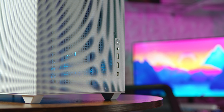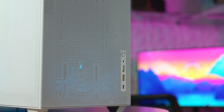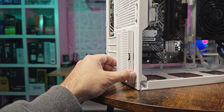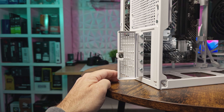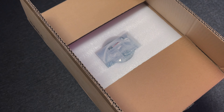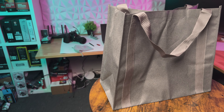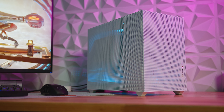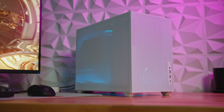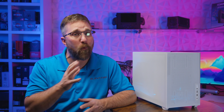Interested in water cooling? Just remove the top fan bracket and attach the expansion box to fit up to a 280 millimeter radiator or AIO. Cable management is okay, with multiple tie-down points and up to 30 millimeters of space. The front IO panel features an LED-lit power button, a headset jack, two 5-gigabit Type-A ports, and a Type-C port with up to 20 gigabits of throughput. At the back, you'll find five replaceable PCIe expansion slots. All included hardware comes in a divided plastic container, and a fabric carry bag is included. At the time of filming, the Sama IM01 Pro retails for just $65 US.